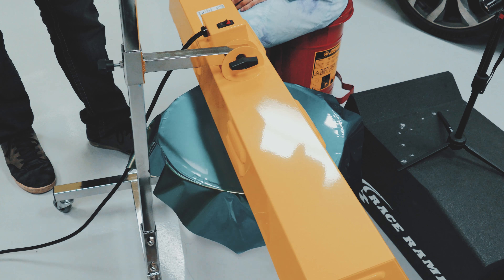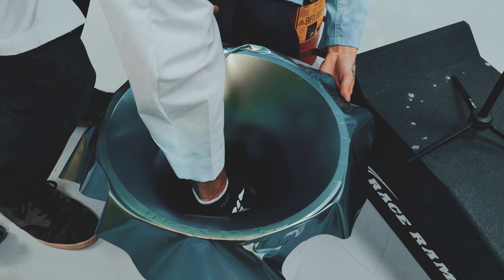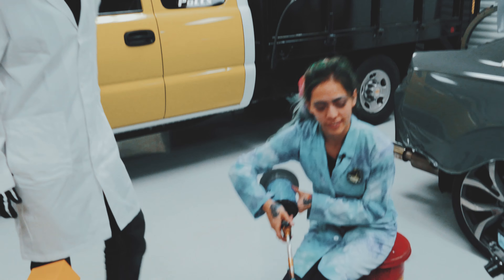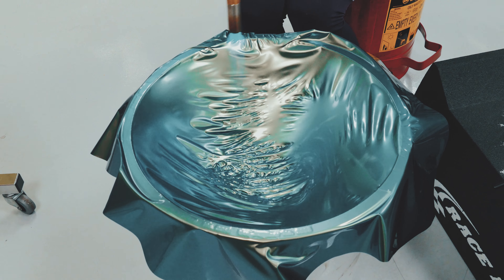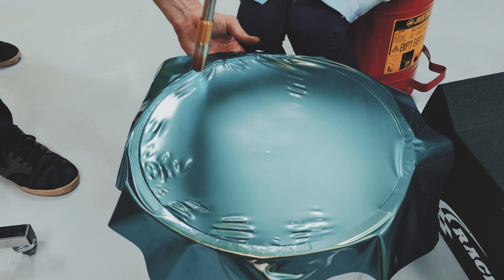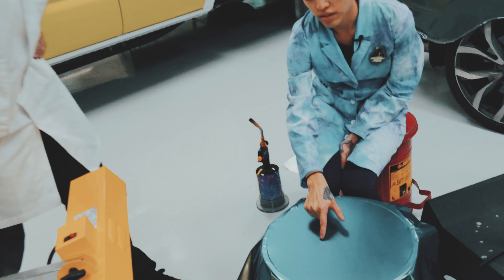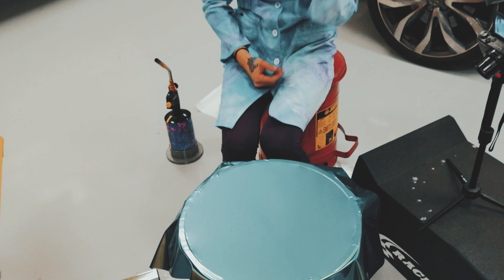Go ahead and punch it. Eleven inches — alright. That came back really nice, but I do see knuckle prints. But you didn't get the radial stretch marks like you did on the other two materials — you got knuckle prints instead. That went pretty smoothly, and that could possibly be because of the metallic finish. When you're dealing with pearls or metallics, that affects everything. The glass in them can actually separate and start making the material look different, or it can make the material more brittle.